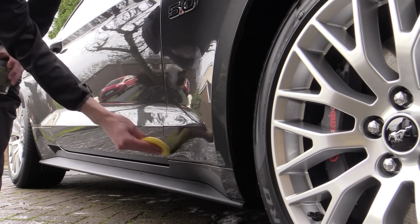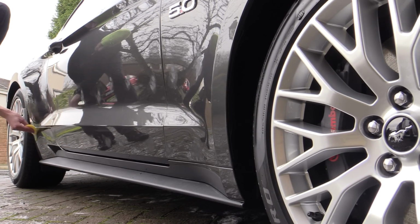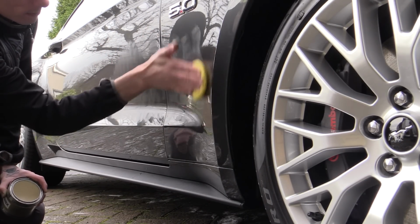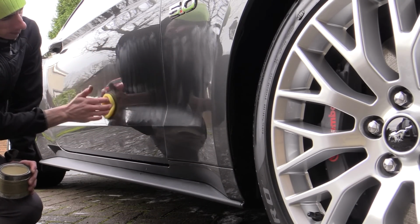As with all aspects of the exterior car detailing process, the lower areas were waxed last, as even though the car is technically clean and contaminant free, you're more likely to pull a stray dirt particle out from the lower parts, and with the upper parts already treated, potential scratches and blemishes, although rare, will be less visible on a lower sill or bumper.